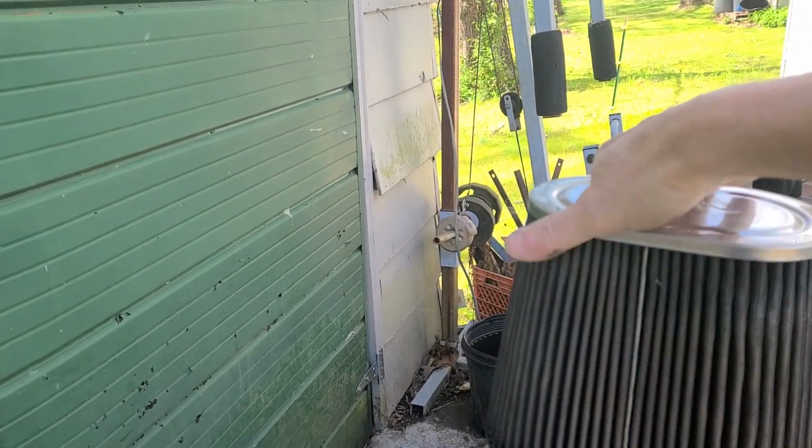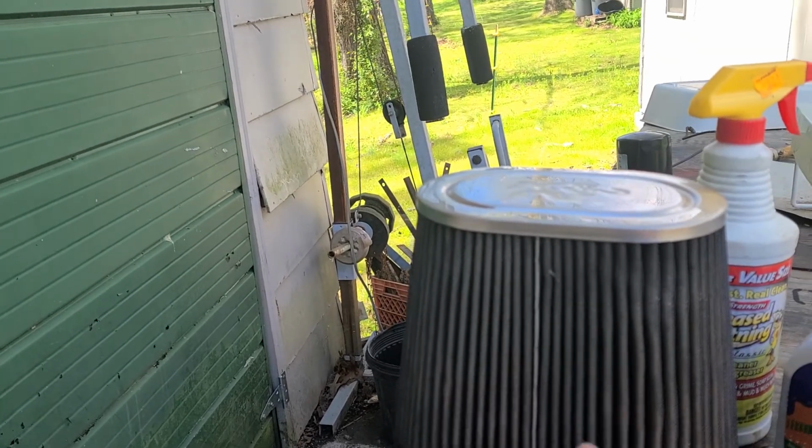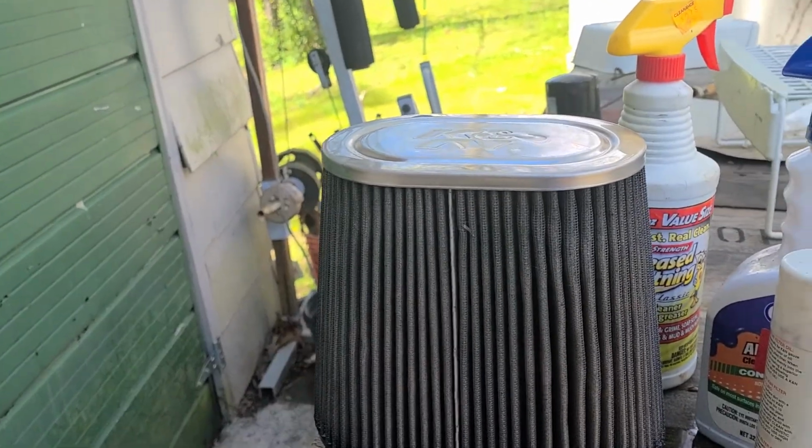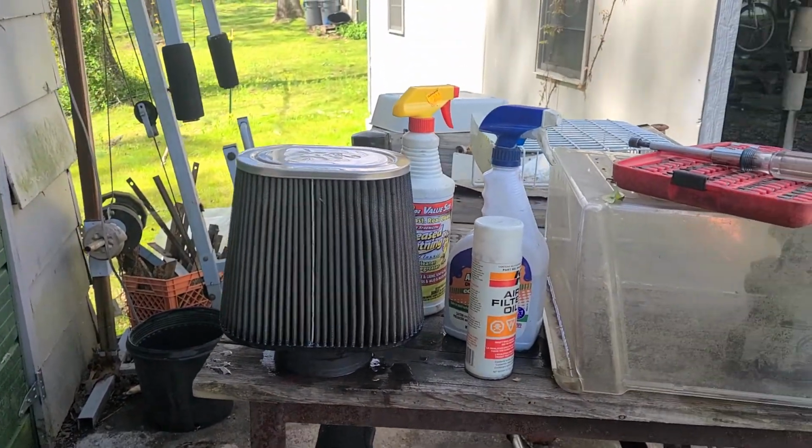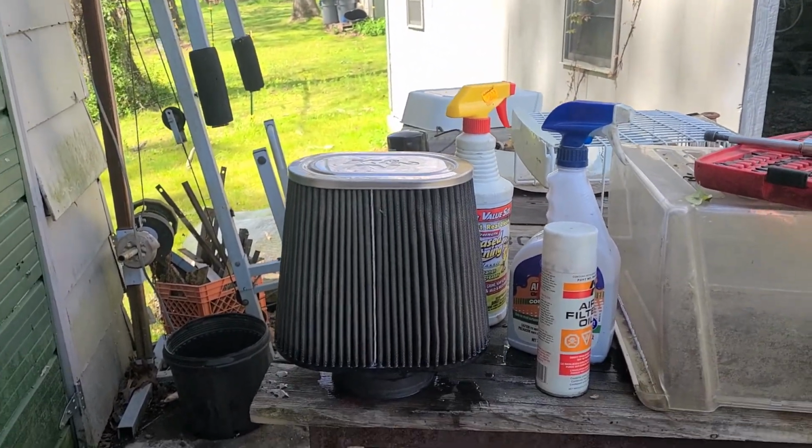As you can see, all the water is just running down here, and it's collecting down here, and it's running out. So, water hoses. So let's recap. Water hose only. No compressed air. No pressure washer. No solvents to clean it. Some sort of degreaser type soap. Okay. So, something like that.